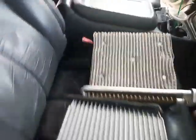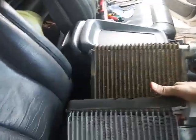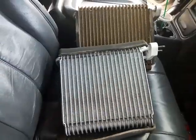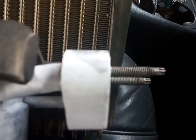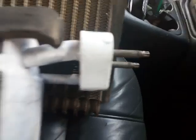However, I have the evaporators here. Here's the old evaporator — it looks fine, but they did a dye test and said there was a leak. I think for about $40 on eBay, or you could go to partsgeek.com and get them pretty cheap. These bolts that hold down the evaporator, you'll have to take them off the old evaporator and reattach them to the new evaporator.